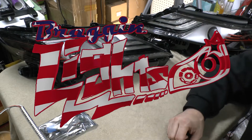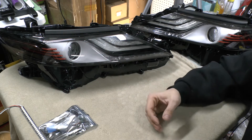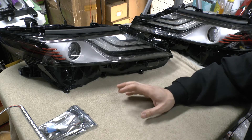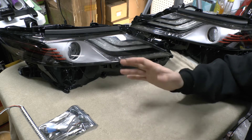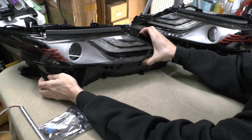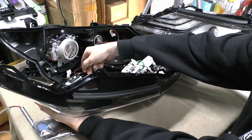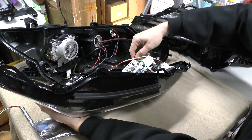In this video, I'm going to be going over how to run multiple voltages within your light — so you can run 12-volt or 5-volt. A lot of the new stuff that I'm selling now is 12-volt, but it is compatible with 5-volt RGBW LEDs as well, the addressable kind at least. I'm going to show you this light that I just finished up, as well as go over some of the wiring things that I do that are just a little bit better for compatibility.